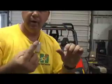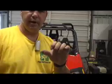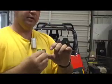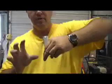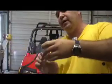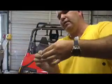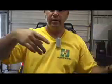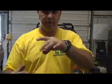Alright, first thing we want to do is we got about, let's see, 2, 4, 6, 8, 9 rubber grommets to put in, okay? You may not even tell that the windshield's here, so clear, but anyway, here's a hole right here. What you want to do is push that grommet through. I just kind of squeeze it through the hole, put pressure on it, and then I kind of start flicking it with your finger on the back and pulling it through.